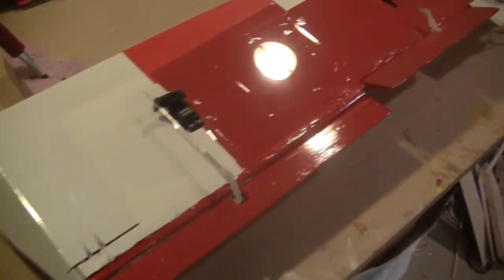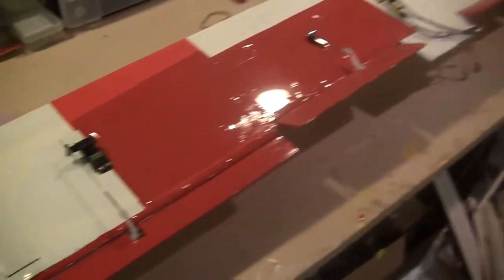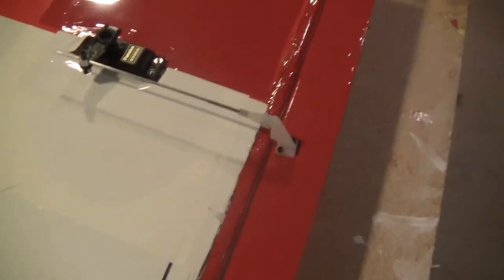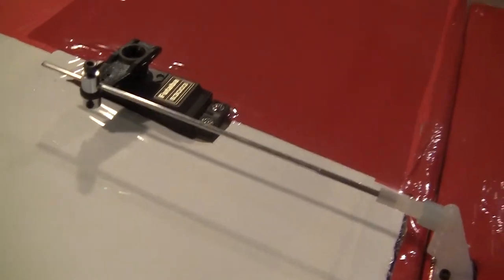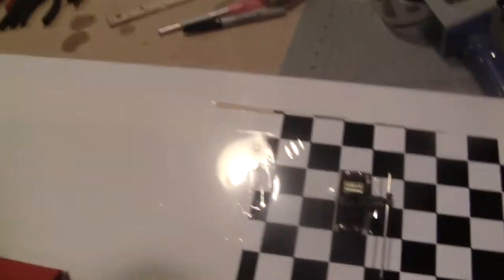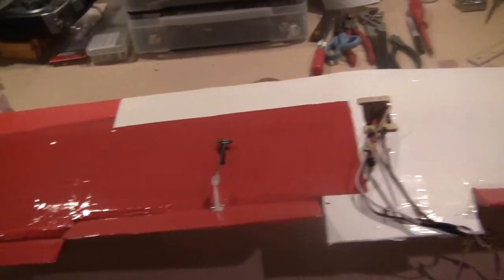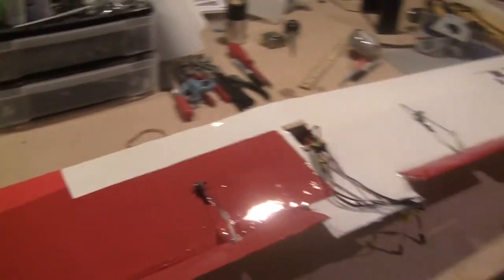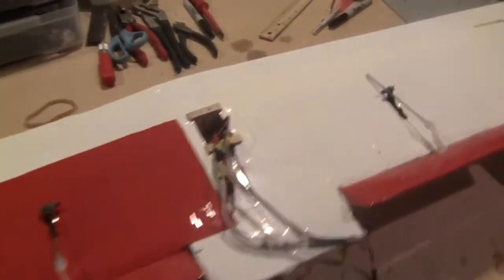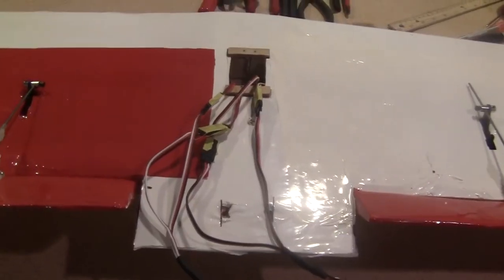Here's a close-up of the wing. Each of the four servos is just a Futaba standard S3003 — they're new, not 20 years old like the other ones in the fuselage. Just a standard pushrod to the control horn, and a Dubro Easy connector for the ailerons and flaps. I ran out of white covering here, as you can see — most of it I put on that Tiger II I had back in April, which crashed a month later. I actually gave that away. And then all the wiring running out right here for the ailerons and flaps, and it's still attached by rubber bands. This is where the former single servo bell crank operation was. I just removed that. Turned out nice — I'm pretty happy.